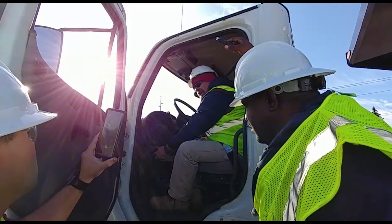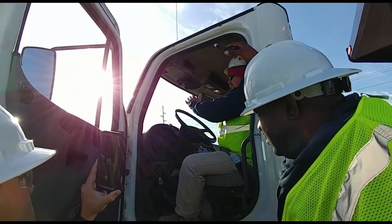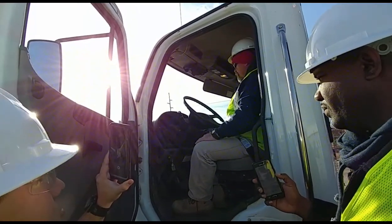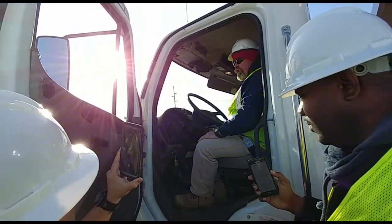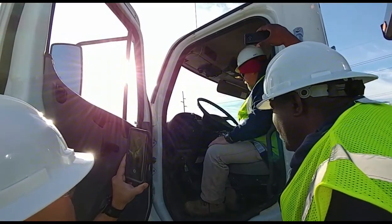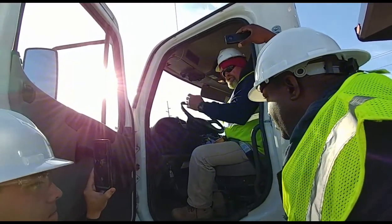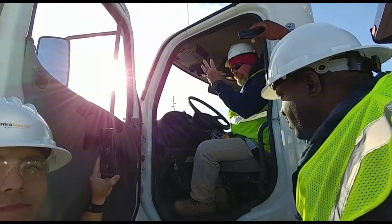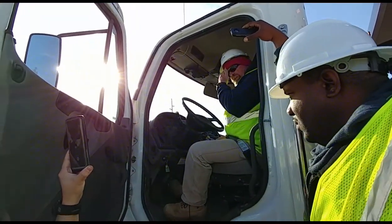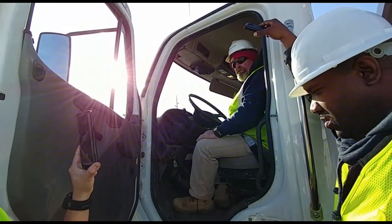Be sure and turn the electrical power back on. Let your gauges cycle. Alright. Then you're going to apply steady brake pressure on the service brake pedal for 60 seconds. You cannot lose more than 4 PSI, because it's the trailer's air brake, so it's 4 PSI. Alright, you hold it for 60 seconds. If he wants the full 60 seconds, give it to him. If he says, okay, that's enough, then you can let off.